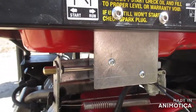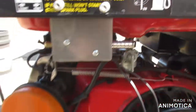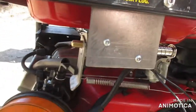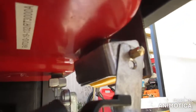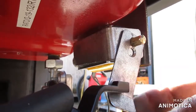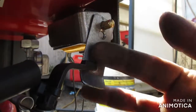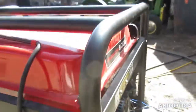I've mounted a push solenoid and made a little pusher bar to push my choke. I had to put a guide on there because that will just spin — so you can see I've done a piece of steel around the body of it so that it can't twist around and has to stay in place. You can see it's pushing my choke closed, and then I've got a return spring pushing it back.